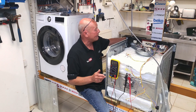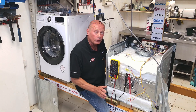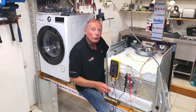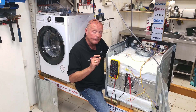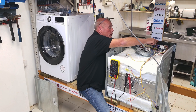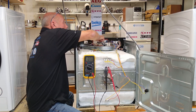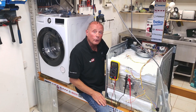There's one other device that can cause problems on a cooker, and this is the relay on the actual timer. Normally a relay is open when you first plug it in. Once you have set the time, the relay is shut, allowing electricity to flow through to the selector switch, the thermostat, and all the components. But if the relay became faulty, then of course there would be no power going to your oven.